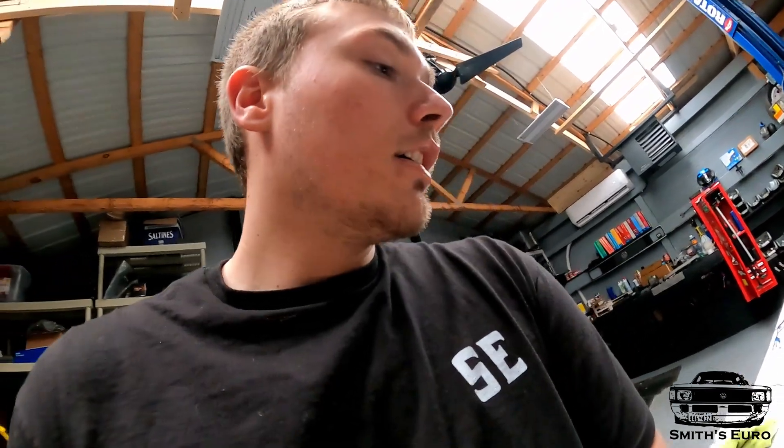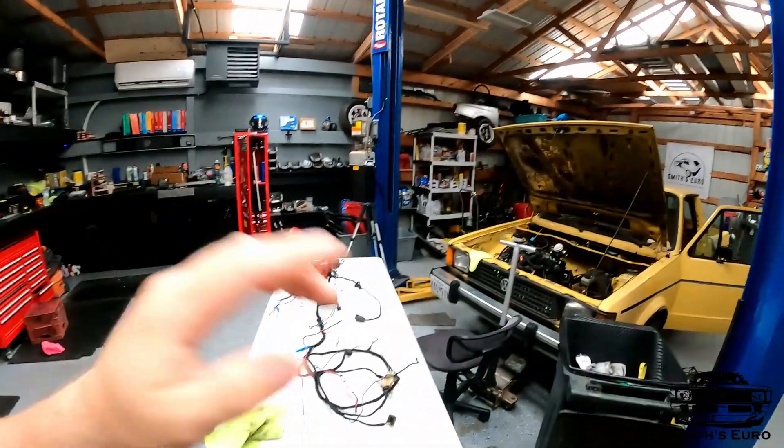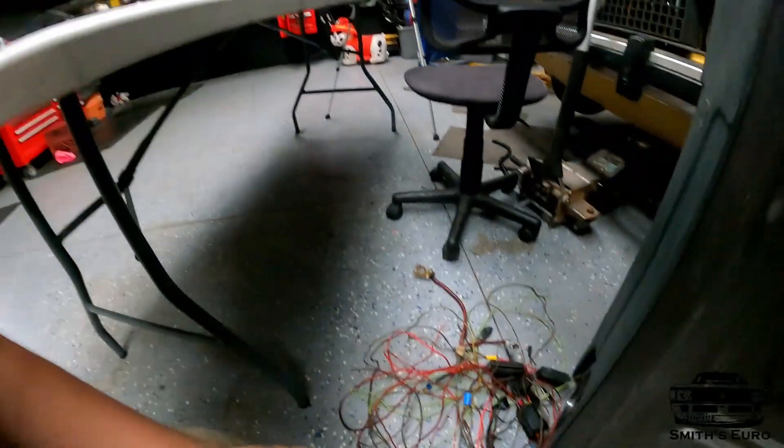Keep in mind this was an AC truck, so it had a lot of extra wiring from the factory. A lot of this wiring was very hacked up, and the rad fan and rad fan switch wiring was so horrendous that I just took it all out. My plan is to make my own sub-harness that runs directly from the battery, fused, to the rad fan switch — when the switch comes on it goes right to the fans. It's the most simplistic way and it eliminates the rest of the chassis from the equation.